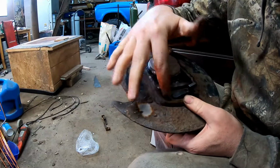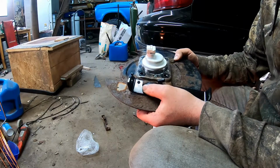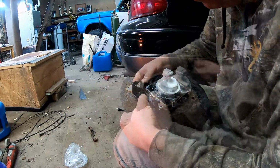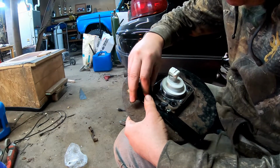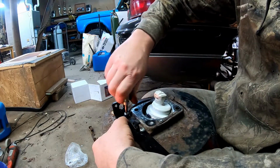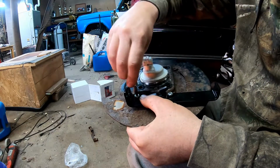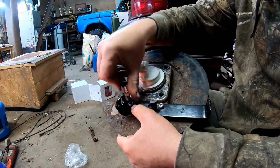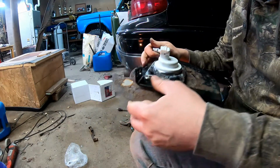lined up on this where the screws are going to go in here. So we got a bracket that goes here, and there's 2 Torx bits that are going to hold that in. What I'm doing now is just getting one of them started. Probably have to wiggle this around and get the other one started here. Oh, that went easier than I thought. We'll just use the Torx bit, get these tightened down. You want to make sure your wheel bearing is in the proper place before you tighten these up, because right now mine's crooked. So we can loosen them up a little. There we go.